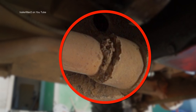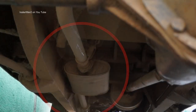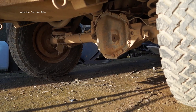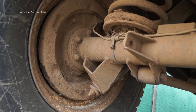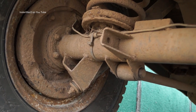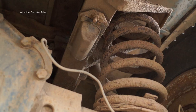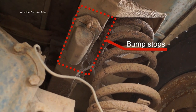Also mindful on this exhaust — it's been modified and welded by hand, and on this part here it's split and it's blowing. The brake pipes have been homemade but they're in fairly good condition, and it's been homemade all the way through. Looking at the rear axle, things to look out for are how the pipes have been attached to the rear axle and whether they're chafing. It's worth checking the rear bump stops to see whether they're present or not — if they're not there, they've either dropped off or been knocked off by being overloaded.